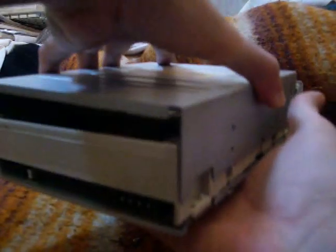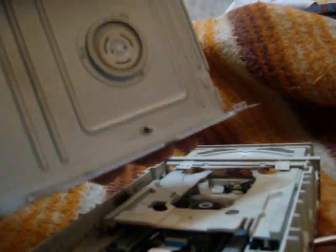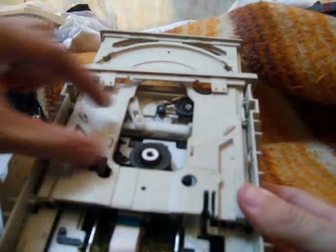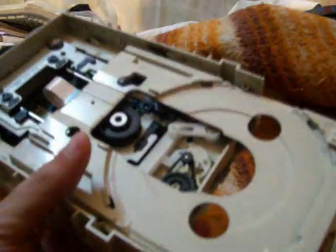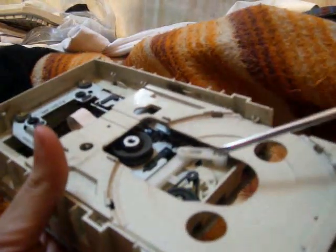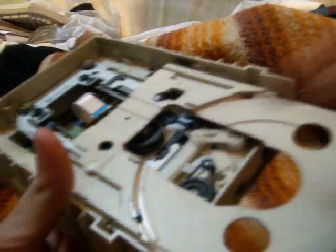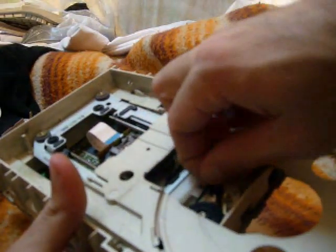Sometimes these screws are on the sides, not on the bottom part but on the sides. Now that it's unscrewed, I will have to... this one doesn't have a back or forth motion, you just pull upwards and that's it. That depends on the model. In this case you will see that the magnet is attached to the top. Sometimes the drive will have a piece of plastic over here with the magnet on top of the axis. You will always find that the rubber band we need to replace — which in this case is this one, you can see there — it's on the front side.